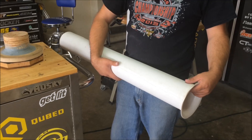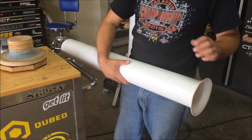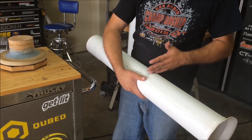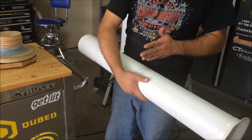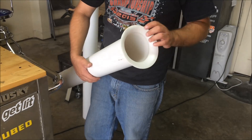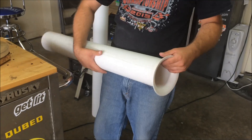Now since you can make a one-piece pipe, what you want to do is on the second end — once you figure out the length — you want to add about an inch or so and cut the pipe there. When you go to flare that other end, you don't want to make it as large so that way it will fit into the box.